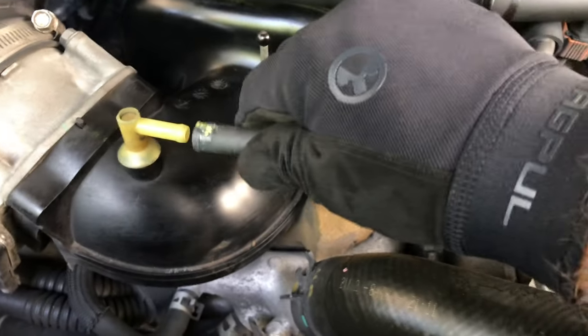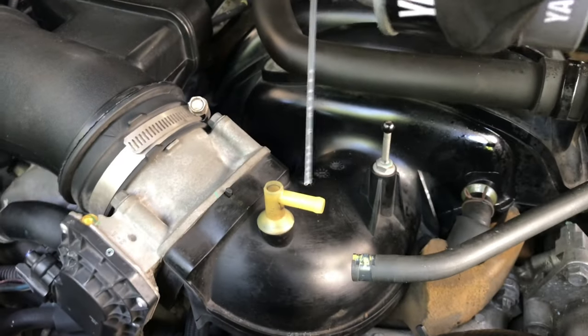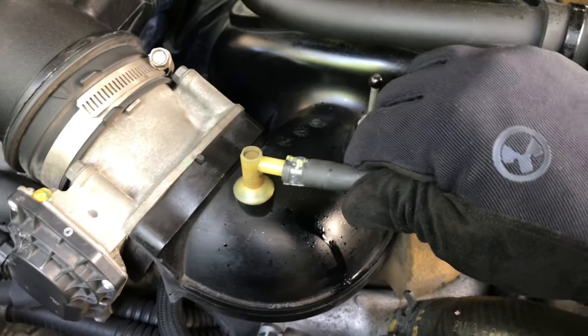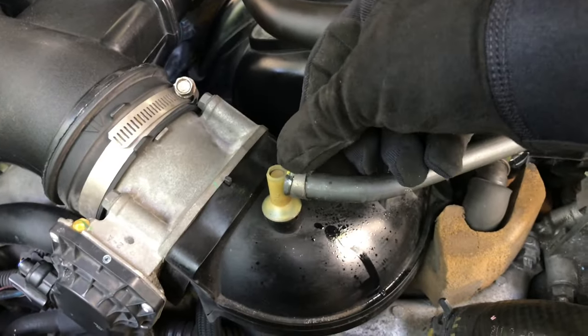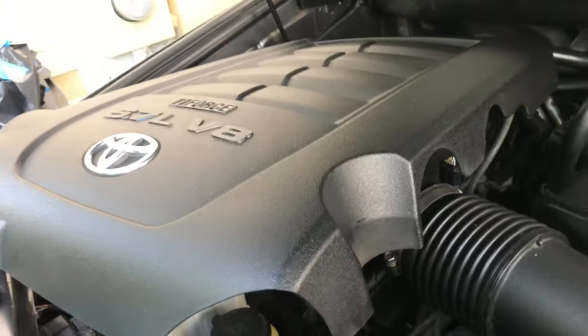Always double-check — eyeball your work. What did I forget? The hose I moved to get access. Here's what I do — a little bit of Yamaha Shield lube and these hoses will slide right on. Everything's plastic, take your time, you don't need to be breaking plastic. Try to find the same imprint on the bracket. Double-check: boom, boom, boom — it's on, it's clamped.